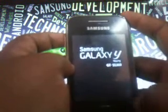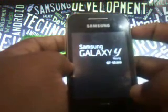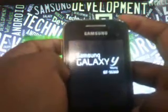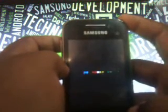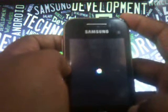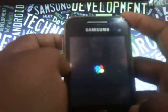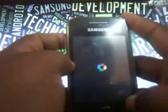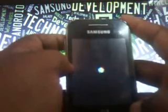You can see the Samsung Galaxy Y Young logo. If this logo stays for more than 5 to 10 minutes, just keep pressing your power button for more than 8 seconds until the black screen comes, then release. This may help you avoid getting into a boot loop. It has a new boot animation of Google, like on Nexus devices. Because it is the first boot it will take some time to get into the main page and load the ROM.